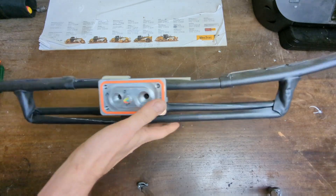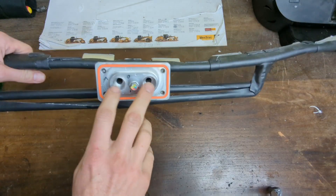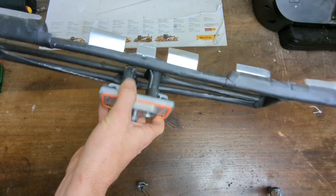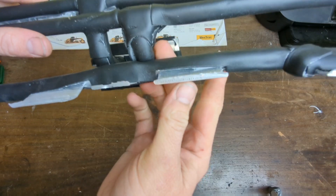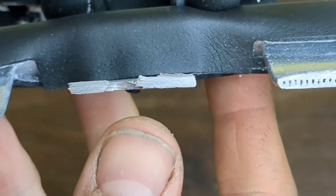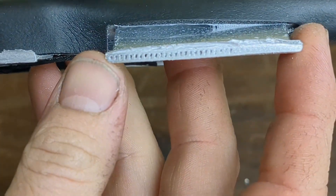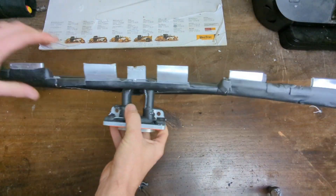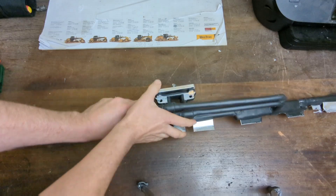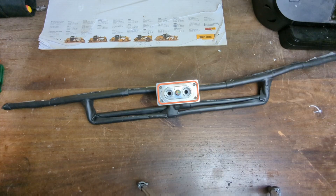One final bit before I go — this is the cooling channels, where the aircon pipes come into the front of the battery pack. I've blanked this off because I'm not going to need all this stuff. You can see each one of these plates, which runs across the top of the battery pack, is just full of tiny little channels for the refrigerant to run through. I thought while I've got it on the desk I'd give a close-up of this for you as well. Alright, thanks for watching.